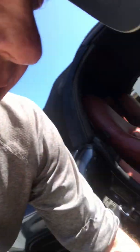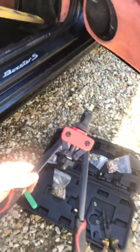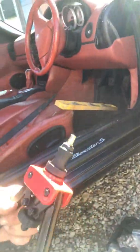Well, I just happen to have a nut riveter. Have you heard of a pop riveter? Well, I've used this before on one of the vans. It's called a colour nut riveter, and here it is. This is the kit. Very handy to use. So when you've got blind holes and you want to screw something into a blind hole, which you can't get access to from the other side, these allow you to put different size mountings in there and fix them in a sense, like you rivet them in.